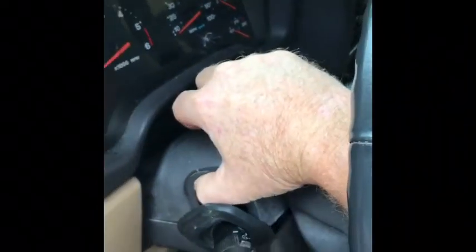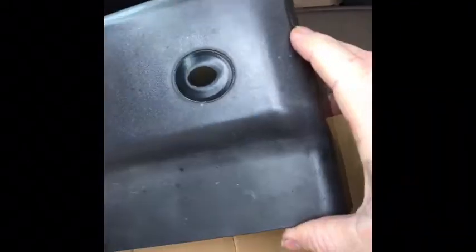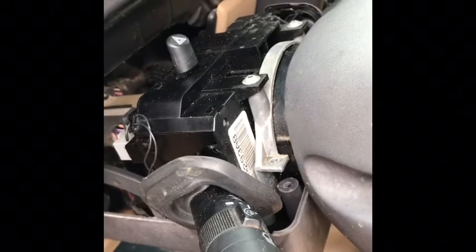Now all we do is remove the top. There's a grommet that will pull back here, and you have another grommet here that simply slides off — may take a little wiggling. This is your light switch. I should mention, this is a 2001 Jeep TJ. They vary — I think around 2000 they changed the switch, so if you have a TJ prior to 2000, you're gonna have a different, simpler switch than this.